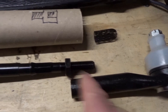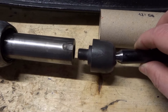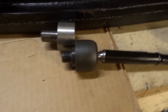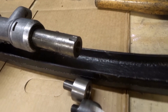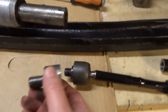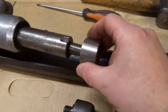The downside is the thread from the Renault Megane inner tie rod is slightly too small for the Porsche rack. This is M14 by 1.5 and the rack is M16 female by 1.5. The good news is there's room enough to make an adapter, so I got a local engineering company to make me two of these adapters.